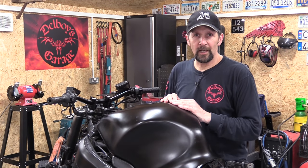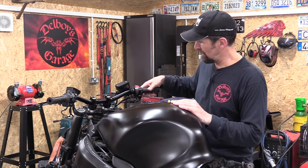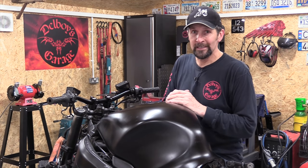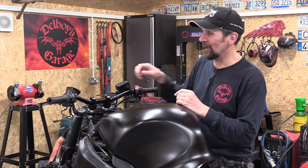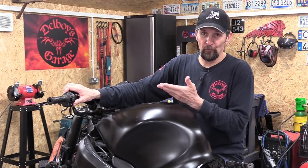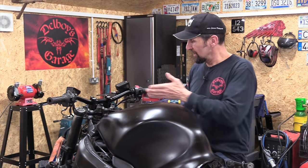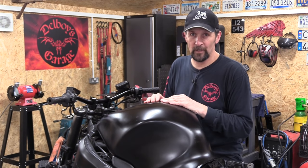Right, there we are. 8 hours in the garage, and I made 3 bespoke control cables. And they work perfect. Now, my soldering isn't up to a professional standard, but it only needs to be strong. It's not an exhibition. I'm not looking for points. Just cables that work, and they do. I'm very happy indeed. I ended up putting 120mm in the choke or fast idle side, and on the throttles, only 50mm extra. And I managed to route them exactly in the factory clip, so the cables are routed exactly as they are as standard, and that's definitely the best way to do it. I'm very happy with that.